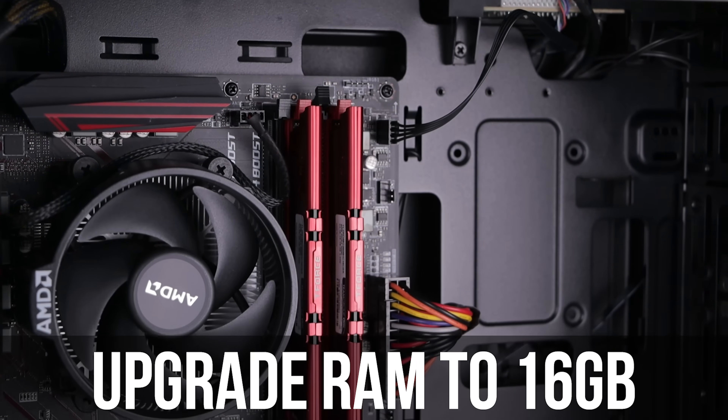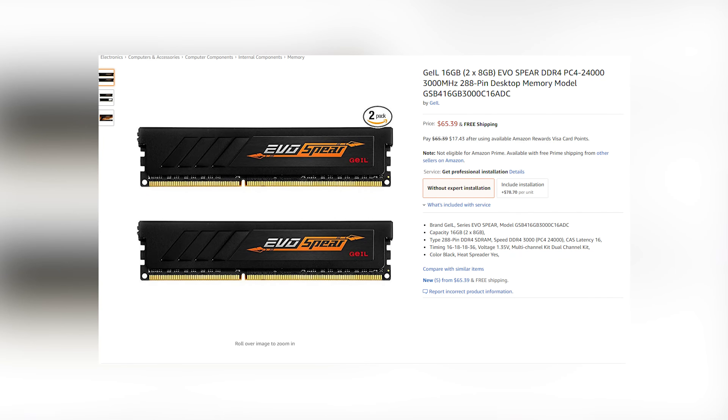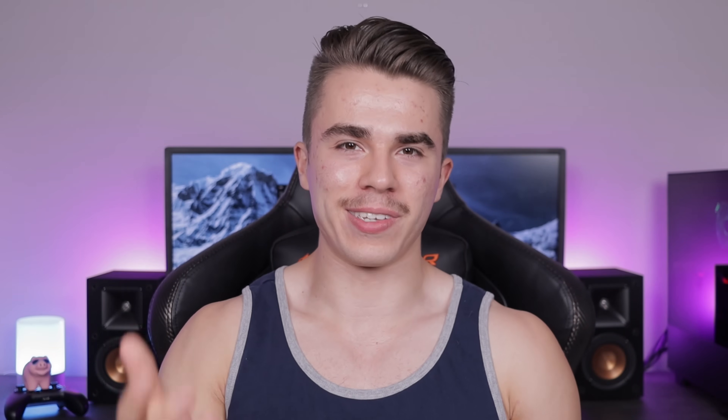If you have an extra $50, the first thing I'd do is upgrade the RAM to 16 gigabytes for an extra $20 to $25, at your brand and speed of choice but preferred around 3000 MHz. Since the APU has no actual dedicated VRAM, it uses system memory, and with 16 gigabytes you'd have 14 gigabytes of spare memory free rather than 6 — and 14 is better than 6 in a lot of ways, potentially giving you better frames per second. That's an upgrade I'd definitely recommend looking at.